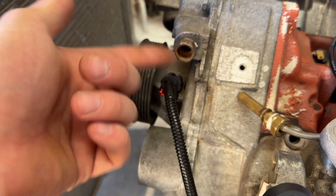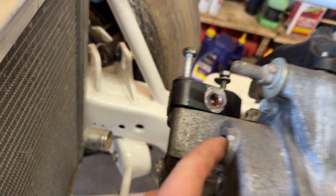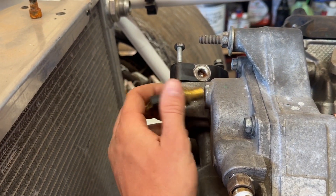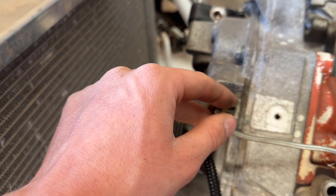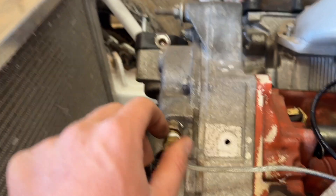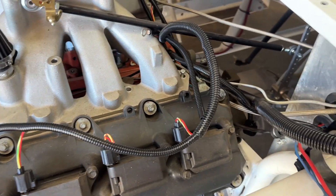Anyways, three-eighths pipe tap — tap that, put the sensor in because this is where my gauges are going. There's also one up here, but I think I'm going to drill that out and put the bigger tap up here instead. That sensor is for the dummy light — at 235 degrees it'll kick on. It's way too small down there and up there there's more meat to work with. Then into your coils, the MAP stays unplugged. It comes through the mid plate and does a 90-degree bend.